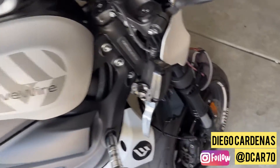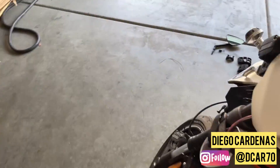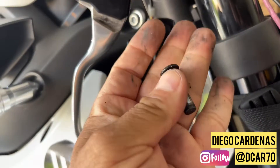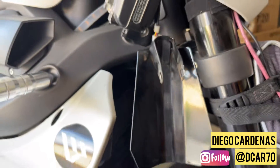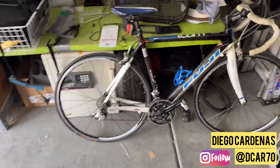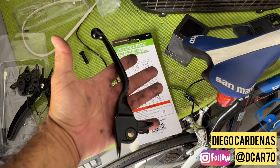For the brake handle itself you'll need the snap ring plier tool. You slide the clip piece off the brake handle — with the snap ring tool you open up the clip and slide it out, then the handle comes easily off. Be careful not to break the sensor that's in there. Here's the broken and busted handle. I was lucky enough to find the Harley equivalent in black — I'll post information on where to get it on the site.